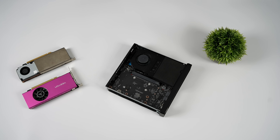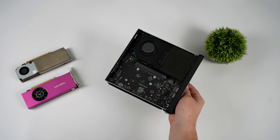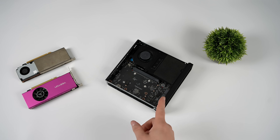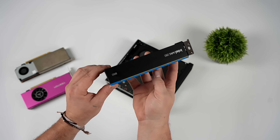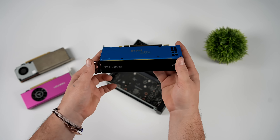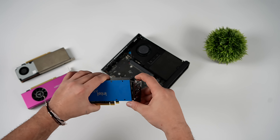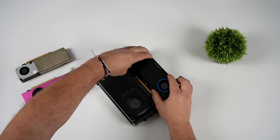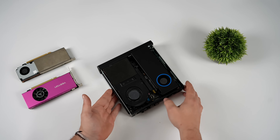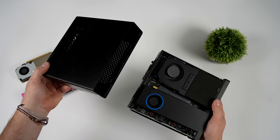If you've got the power supply and everything like that, you still have to worry about the case lid fitting. For me, I wouldn't mind running this without a case, just set it behind my monitor. But for this one, I wanted a card that put out a little more performance than the RTX 3060 or the A2000 and doesn't require any extra power. So I'm going to be installing the Intel Arc Pro B50 — 16 gigs of VRAM, 16 XE cores. The card was really designed for small form factor workstations, but you can still get some pretty good 1440p gaming out of it. To install it, I need to remove the bracket. I've removed the screws from the low-profile bracket and we can slot this right in. One thing to keep in mind: the PCIe slot in the MS-A2 and MS-01 is an X8 4.0 slot, while the B50 is an X8 5.0 card. So there's a chance we'll be losing a bit there, but I don't think it's going to be that much.